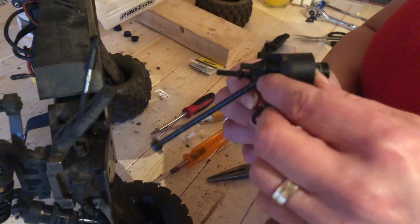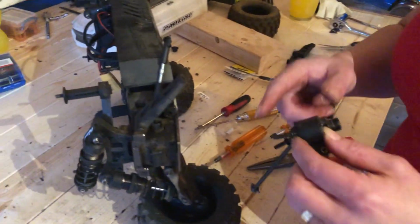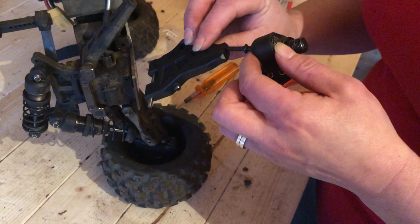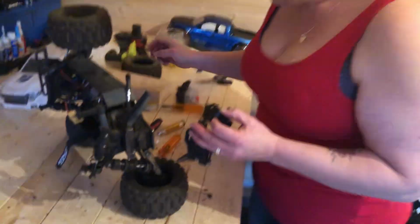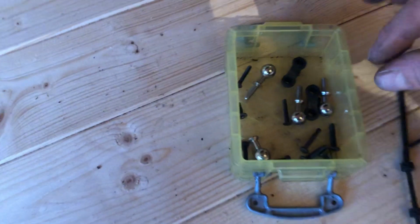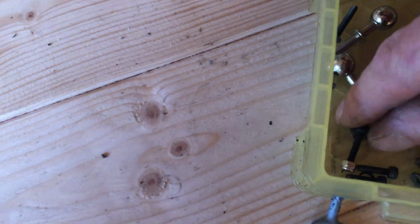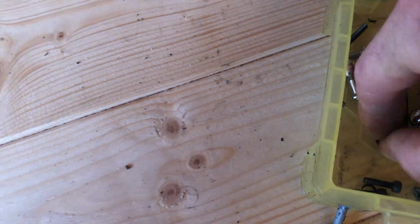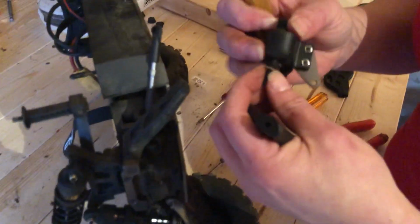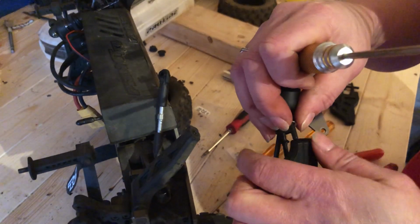That one is the bottom arm, which is the one you've got off. So where am I putting this? Screw that into the arm. Into here. Yep. Oh, don't forget, there is a washer that comes out of there because when it broke, it threw it out. There's a washer that goes on there in between the pivot ball and the arm, which could possibly be why it broke.